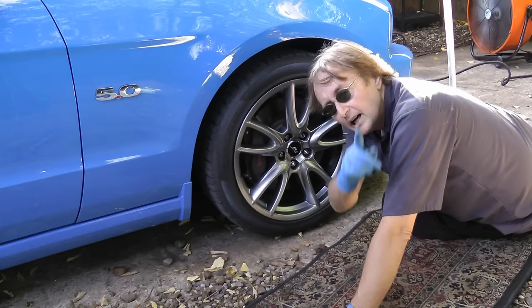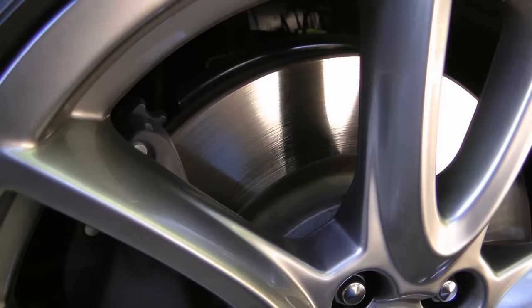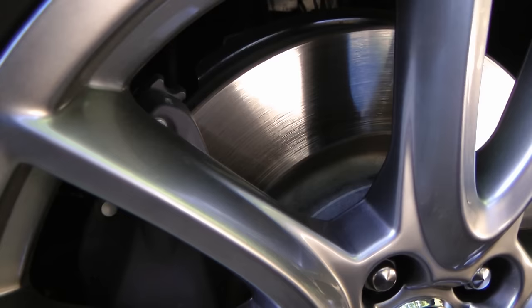Lightly sand it around to get the glaze off the pads. That'll rough it up so when we put the resurfaced drum on, it won't squeak anymore because the shoes will be clean too — they won't be all shiny. Now let's say you have a newer car and the front disc brakes are squeaking. The same basic principles apply: if the discs are too shiny, they can squeak and you can get them turned or replaced.